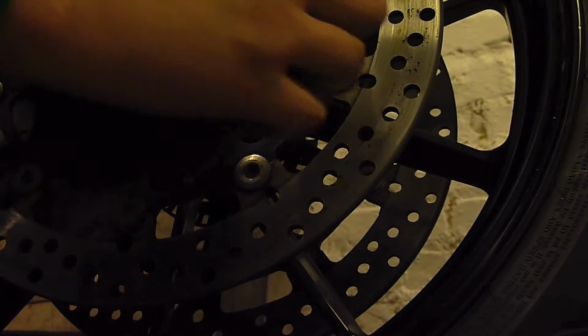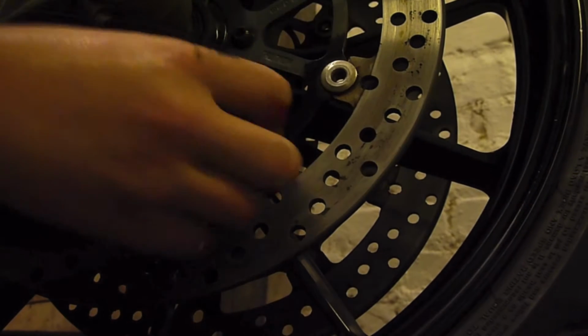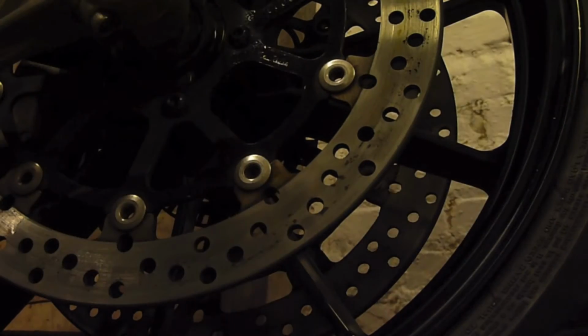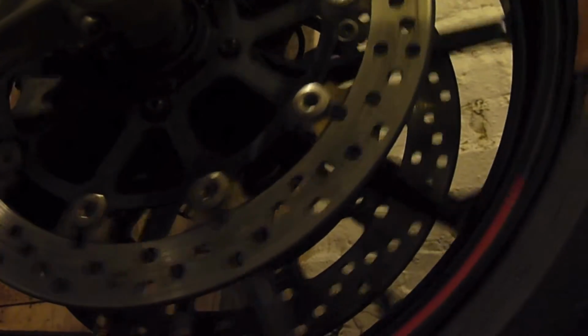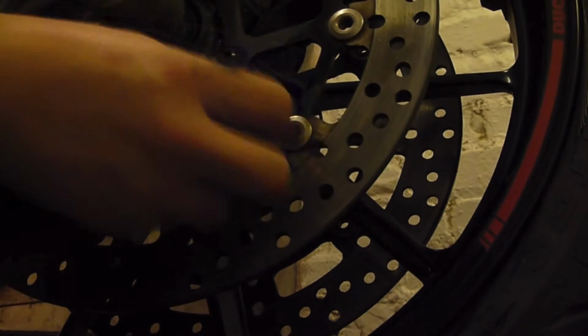Using Scotch-Brite or a similar abrasive pad, carefully remove any existing corrosion, like on the brake disc rivets. I use a little bit of ACF50 onto the pad before very carefully applying it. Be aware of any runoff onto the discs, as they will be rendered almost useless with a product like ACF50 on them.